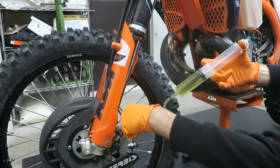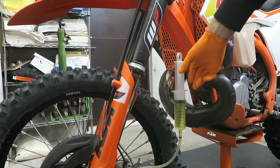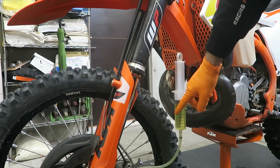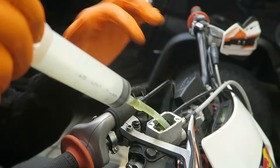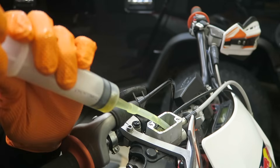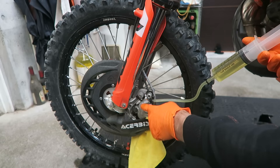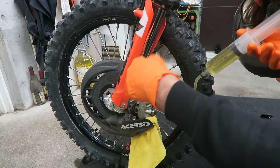When you've done a little bit you can shut the valve off and check the reservoir. When I need to take a break to remove brake fluid from the reservoir, I hold the syringe upright using a piece of wire suspended from the triple clamps so air doesn't get into the tube. Then once you've injected some fresh brake fluid in, you need to empty the reservoir so it doesn't overflow. Then you're ready to inject some more fresh brake fluid. Just keep repeating this process — injecting fresh brake fluid into the drain and removing the old stuff from the reservoir — until all the fluid is changed.